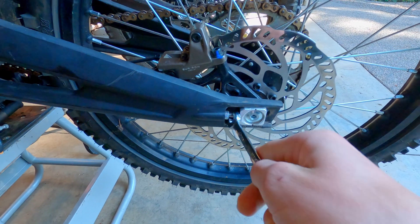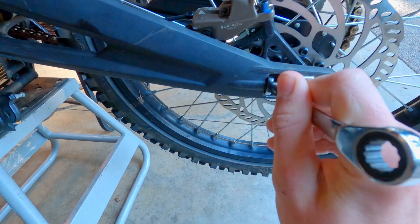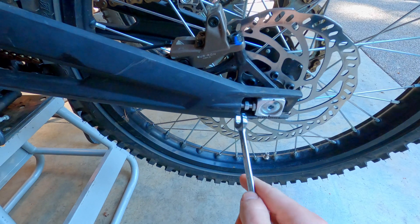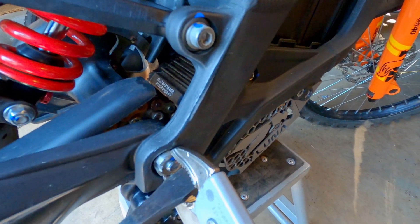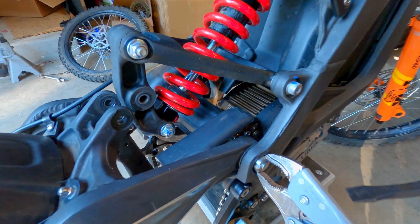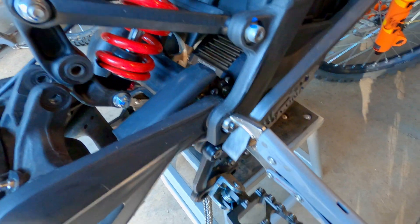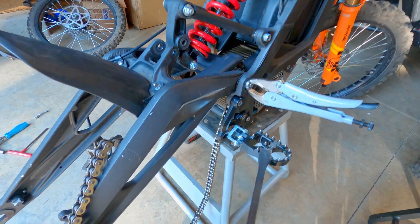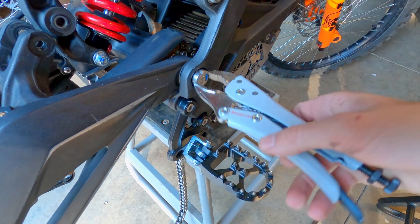The next step is to remove the tension on your chain and remove the rear wheel. At this point it might be a good decision to just bust open the chain and undo the master link — I didn't do it at this point because I didn't realize, but after looking back at it this would be the best time to do it. The next part is a little more tricky: you have to undo the swing arm bolt — it's a through bolt with an odd nut on the other side. You can buy a specialty tool for this, but what I did was take a pair of vice grip pliers and a pry bar, clamped it on there, and then used the pry bar to get some leverage to turn it, and it actually worked quite nicely. I'll be doing the same method to put it back on.